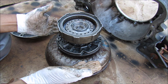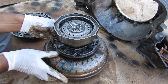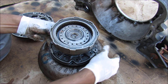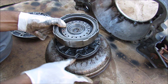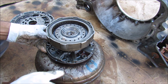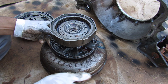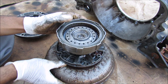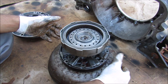There are three main functions to the torque converter in your vehicle. The first is to allow a little bit of slip — so for example, if you're rotating your engine you can see the input shaft to the transmission is rotating, and if you come to a stop the torque converter will keep rotating and allow a little bit of slip so that the engine does not stall. The second function is to lock the input and output of the torque converter together, which usually happens at cruising speed to make power transfer more efficient. The last function is torque multiplication, which helps the vehicle take off from a slow speed.